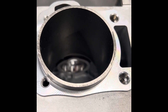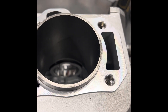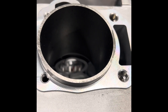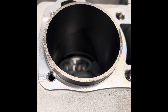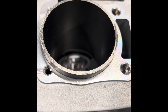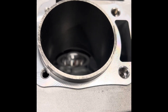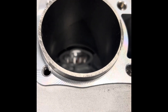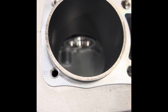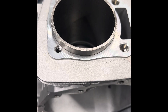Compare that to regular sleeves. If I bought a sleeve from, say, NR Racing or EC, the OD on that sleeve would be about 160 thousandths smaller than this OD right here. So you have 160 thousandths more sleeve on the walls of this if you bought it to 3-inch. Now this one is going bigger than that, but this would be the same sleeve we use in a 3-inch bore.